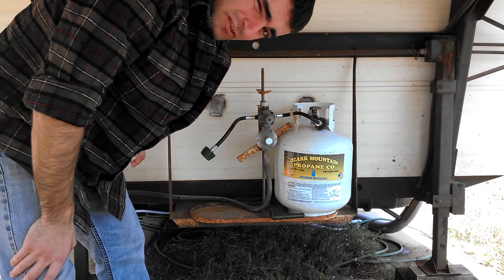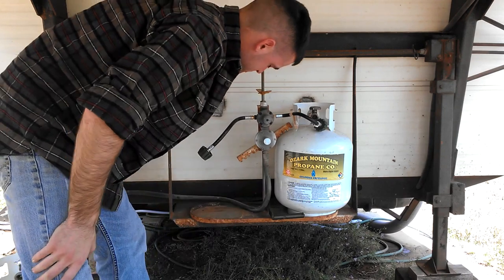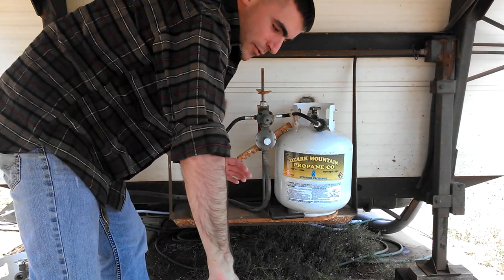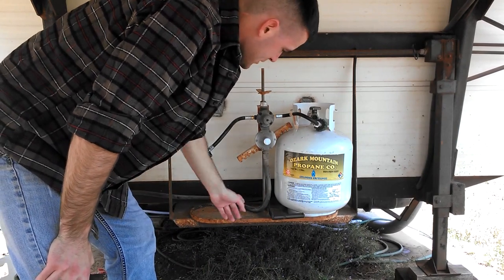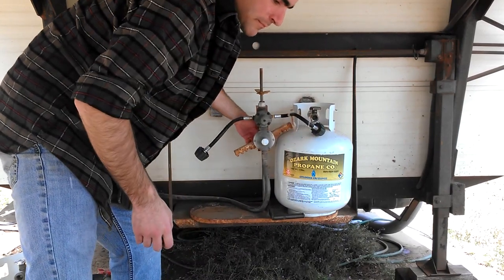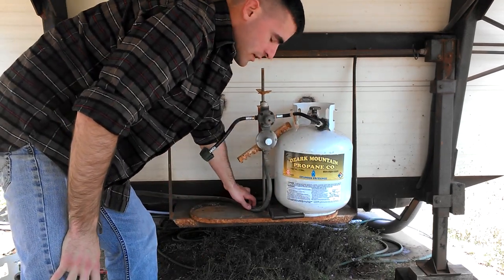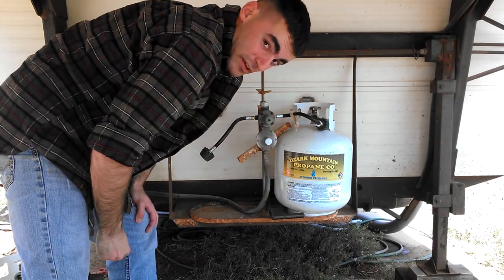What I'm going to do is undo it here and pressurize this to about 90 PSI, then release it and stop quickly. When I pull this out, if there's no pressure blowback, it means air is flowing through just fine. But if air blows back at me, it means I've pressurized the whole system and there's a blockage — probably this piece right here that needs replacing.